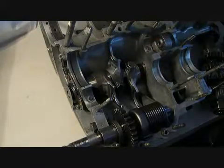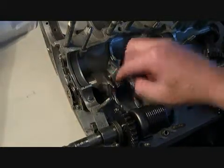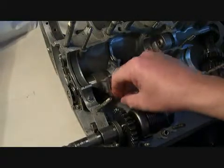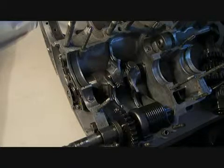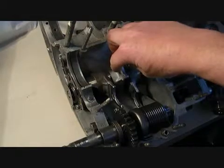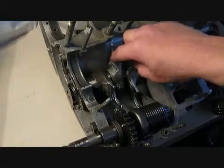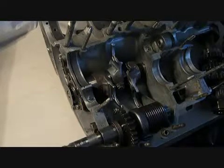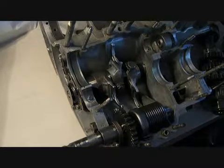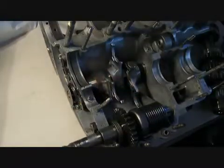Your shift forks — always check for bends or burns. First gear is usually the one that's burned up really bad, so make sure you check all the forks for damage. Light burning is common with most of them, so that's not a big deal. It's when it starts cutting into the metal — if you have any kind of lip there you really should replace the fork. First gear is difficult to find; the other two are not too bad. Make sure your forks are straight and not what I call 'ditching,' where it cuts a ditch in there.